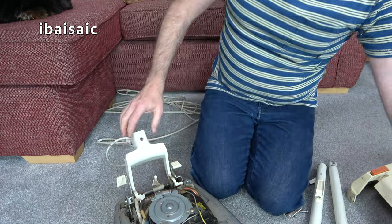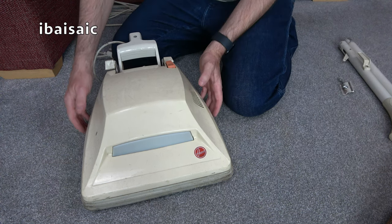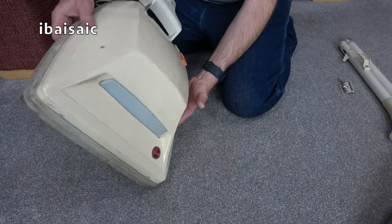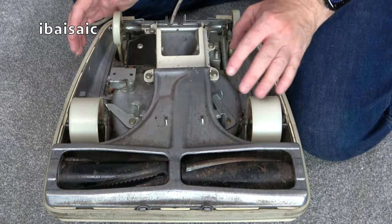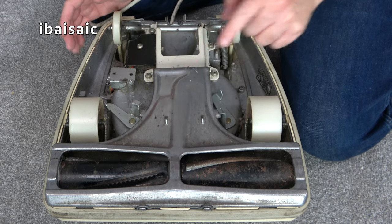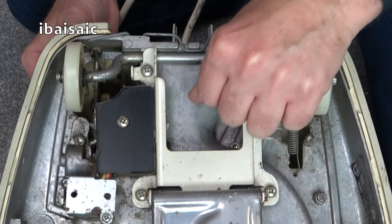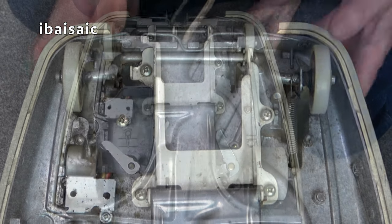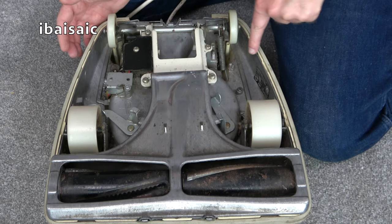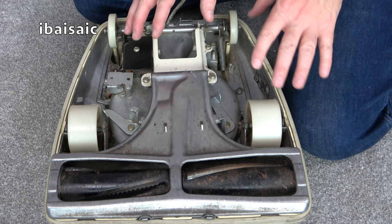I'll manoeuvre the hood back in position. And then we'll have a look at the underside. The hood went back on easier than it came off. So let's turn it round. I expect this will need new brushes and certainly a new belt. Looking at the brushes — yes, it does. This has got the two-speed switch that increases the motor speed when you slide in the tool converter at the back. We'll have a look at the model — I can just see the rating plate there. We'll have a look at that shortly, and we'll be able to date this exactly.